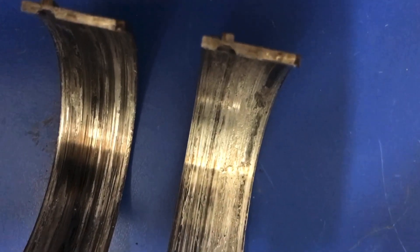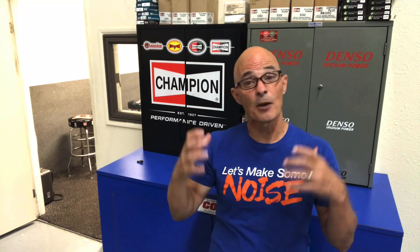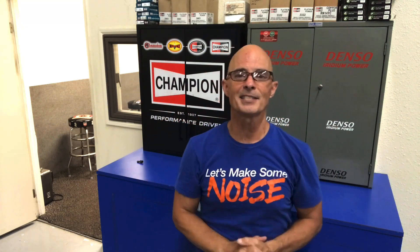So that crank is no good. The bad news is that it looks like I'm going to need another crank and rods for the 4.3-liter V8, but on the plus side, I get to take another trip to the junkyard. As you saw from the photos and video, I was not able to save the crank or many of the connecting rods. That dark blue color on the connecting rods tells me they got really, really hot — I don't want to reuse them. It's much easier to throw the whole thing away. I'm going to go to the wrecking yard, get another 4.3-liter L99, and start over. I'll take those internals out and combine them with the block and pistons for the 5.7-liter LT1, thereby creating a Gen 2 DZ302. If you guys like, share, subscribe, and ring the bell — I'll keep testing.